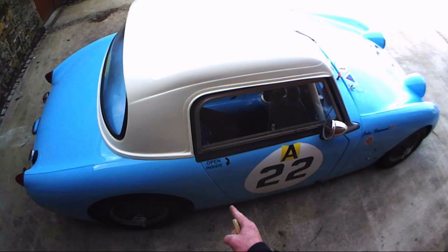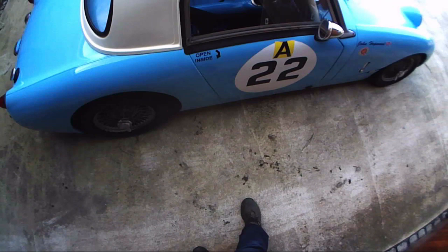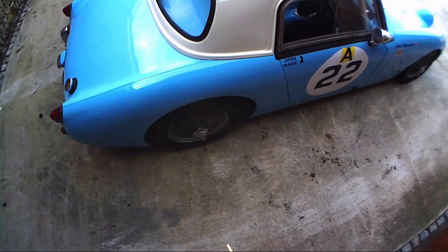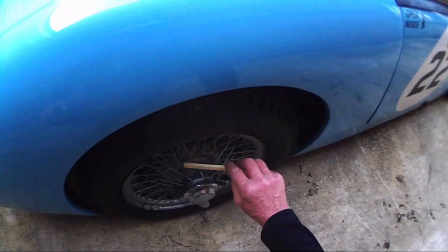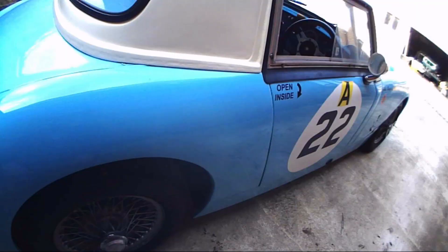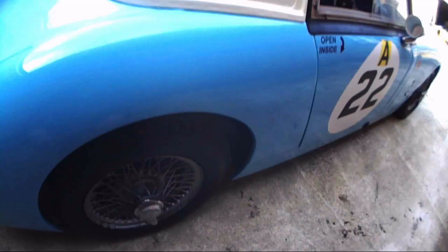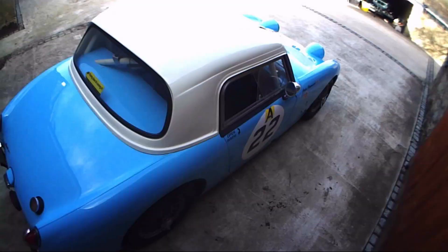Walking round to the doors — this car never had external door handles, so it must have markings to indicate how you get inside the car. Look at the wheels: you have wire wheels here with the central spinner. You can check the spokes easily — just go round. If you don't hear any dull spokes, you know it's okay. The car has wheel studs; one and a half times the wheel stud diameter must be engaged in the nut. If it's a closed-end nut, feel free to ask the competitor to take a nut off.